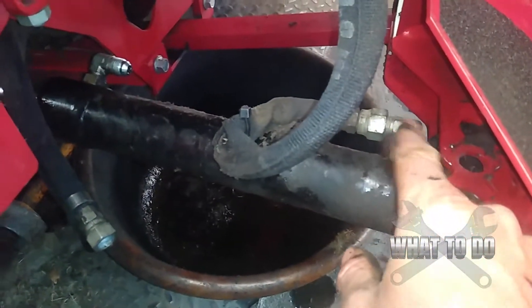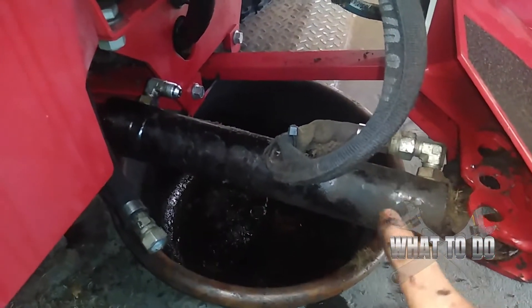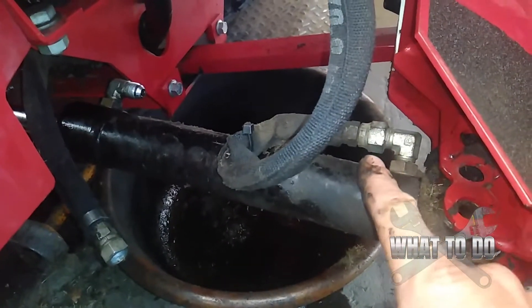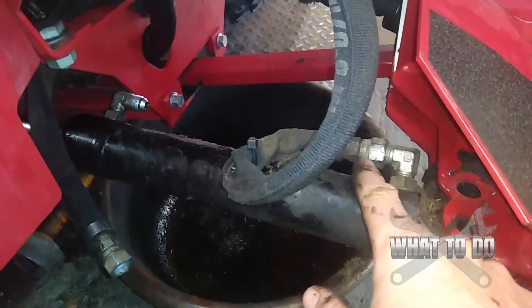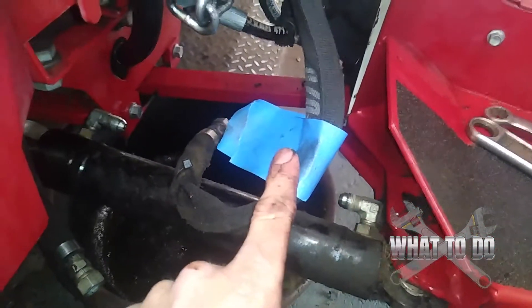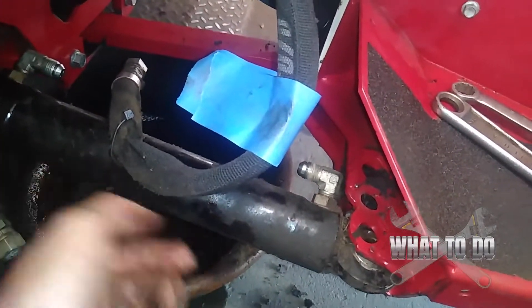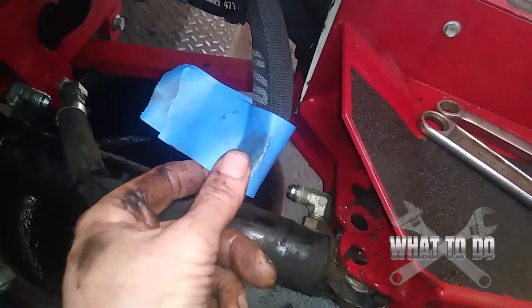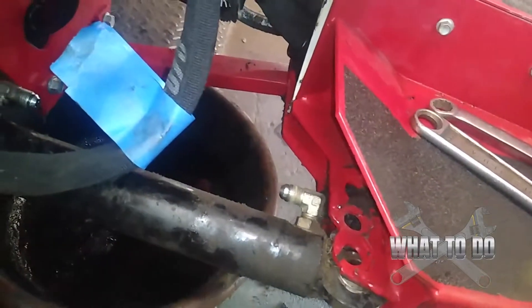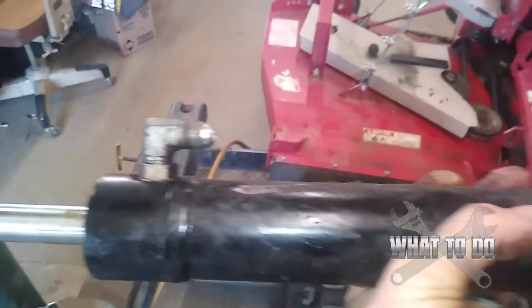These fittings you don't have to take off right now. When we take this hose off and pull the cylinder out we're going to do these on the bench and then put them in the new one. Let me take this off — same process as the other one, put your wrench on and break it free. I got this one loose — no fluid out of there. I put a piece of tape on here telling me this is my front line. Remember this is flipped around, so this one will be the front. I put one piece of tape on the blue line to mark it as the front. Now we can pull this out and we're free.